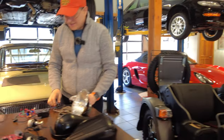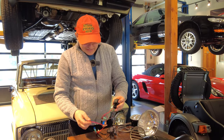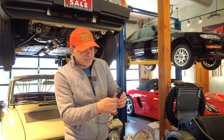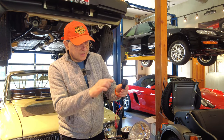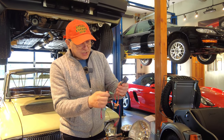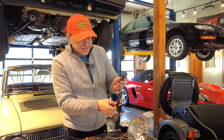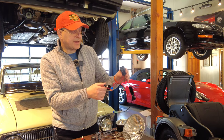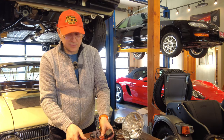The next electrical item is this little set of wires — a solid-state relay. It looks like a relay but it isn't. What it does is act as the hazard light switch; once connected, you'll be able to turn it on and have hazard lights on the Ural.